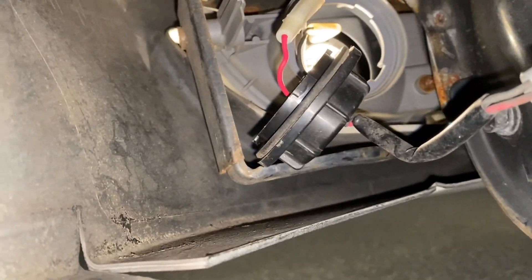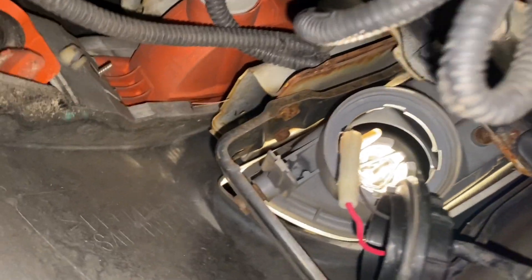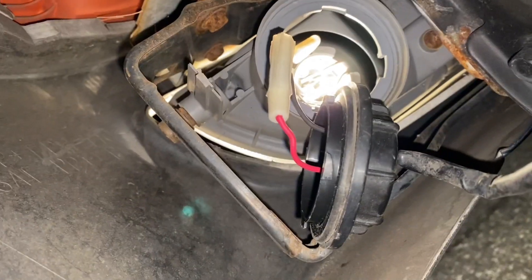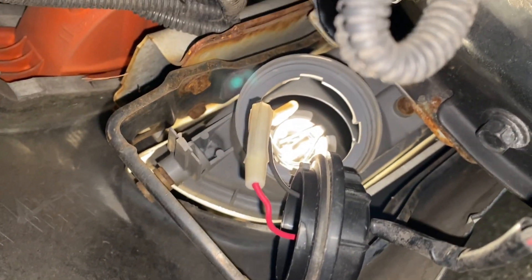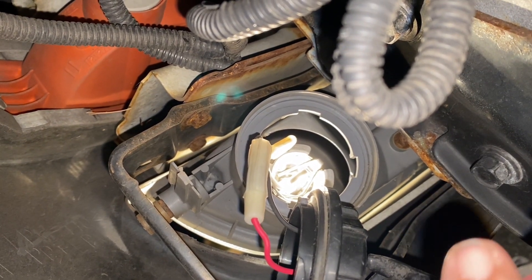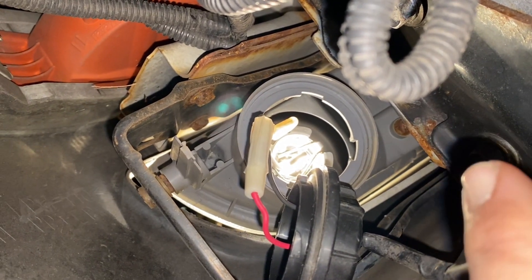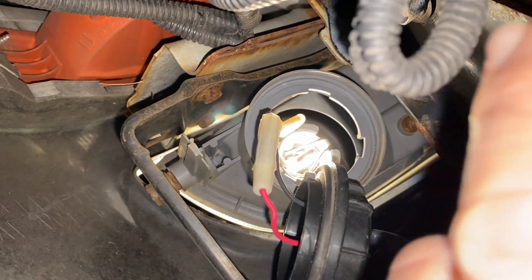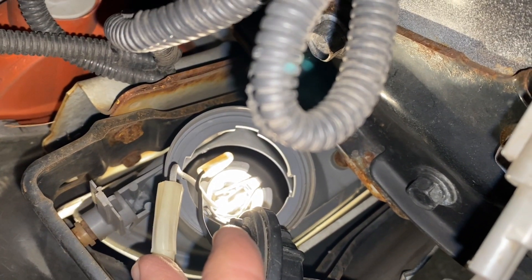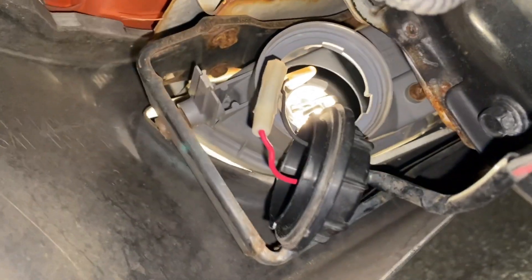There's a little metal clip that holds the bulb in. The bulb sits in there one way only — on the top there's a little rounded point and on the bottom there's a little squared-off point. That metal clip just pops in over the bulb and latches in; you have to bend it under. Then you plug one connector in and the other gets plugged into the housing, which completes your circuit.